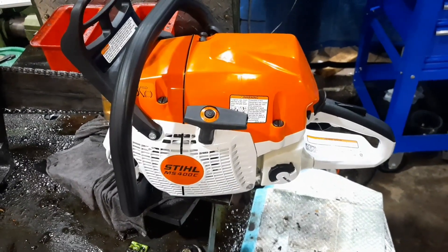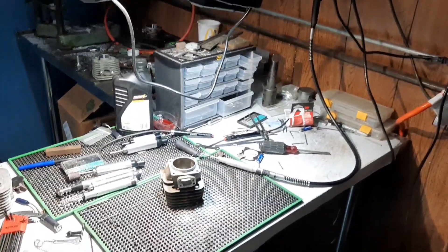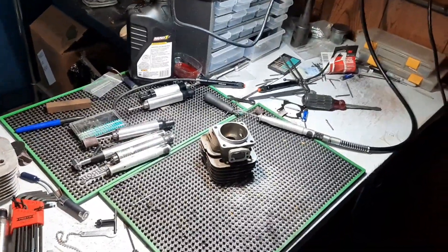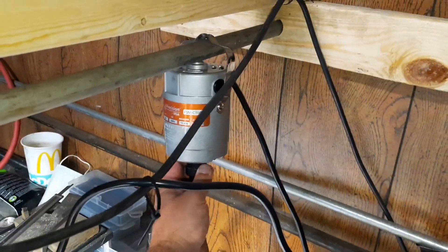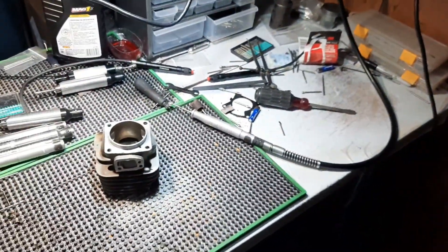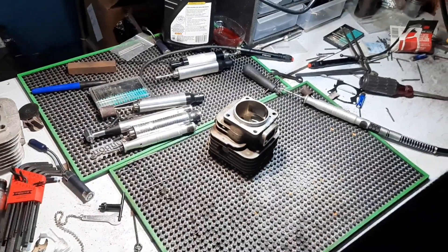Get some baseline runs on this MS400 — this one will be getting a full video too. Over here is my messy porting bench. Don't mind the clutter. That's a couple of drop lights tied up top. My motor can slide, just so it doesn't bind up. If your motor's mounted too hard, it'll snap the cables a lot. Normally have a cylinder over here ready to port, a saw or two torn down, some pieces on the lathes.